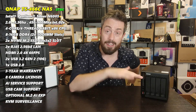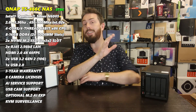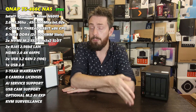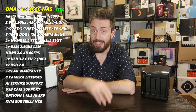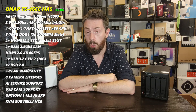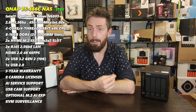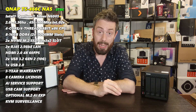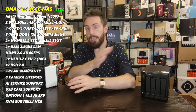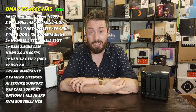The N6005 is higher in many of its capabilities — not just clock speed — than the Celeron. It arrives with a 2.0 GHz base clock that can boost up to 3.3 GHz when needed, over four cores and four threads. It also has integrated graphics on board ranging at 450 MHz that can go up to 900 MHz, giving it a higher graphical capability than any of the Celerons including the J6412. Memory options are either 8 or 16 gig of DDR4 across two SO-DIMM slots.